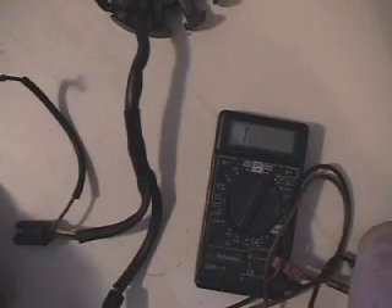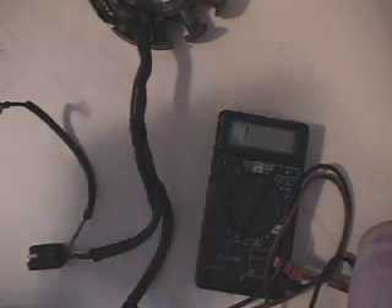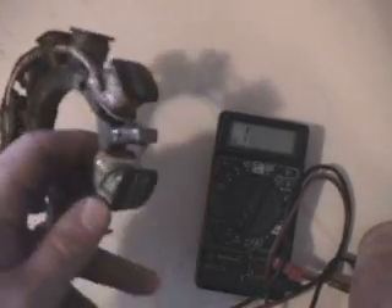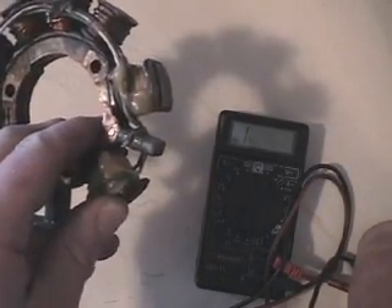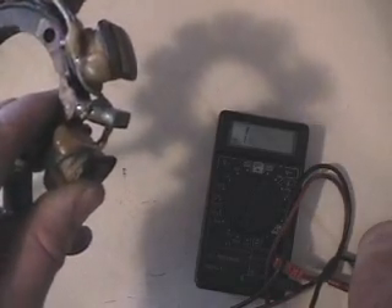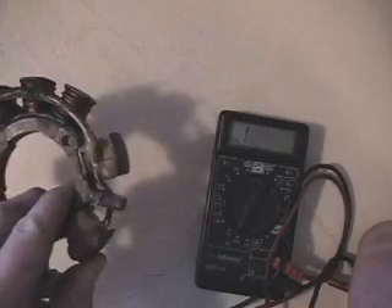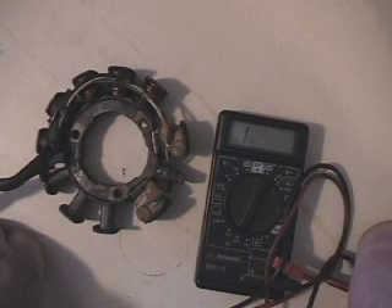The one thing I forgot to mention: if either one of those reads much higher than 450 at room temperature, they are bad. Ohms are a direct result of the amount of wire on that bobbin, on that coil — they wind it so it's exactly 450 ohms. If it's cold, it'll read a little bit lower; if you've been running the sled and it's warm, it'll read a little bit higher. But if it's cold or room temperature and either coil reads much higher — even if the primary reads 455 at room temperature — it's bad. You don't just get more wire on there; you've got more resistance from somewhere, and usually that's due to internal shorting.